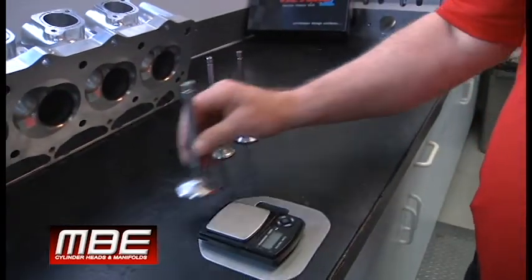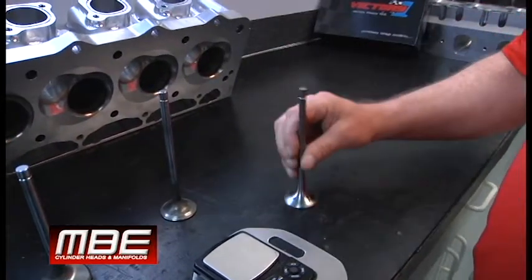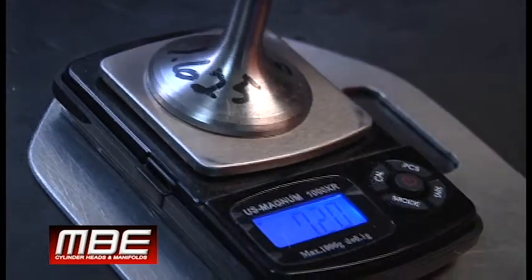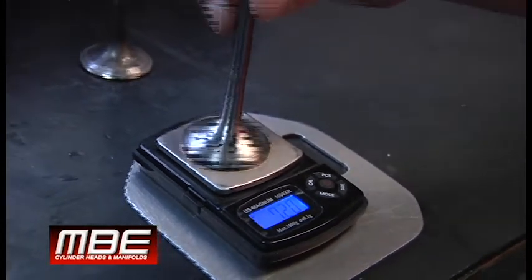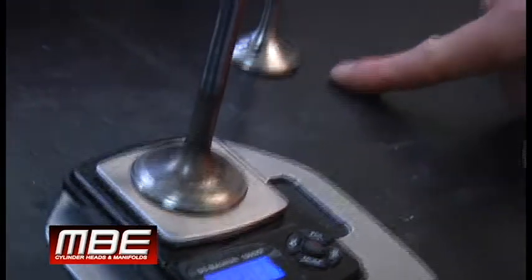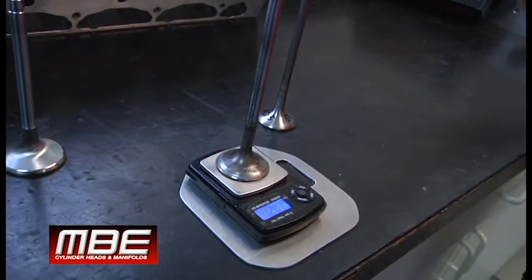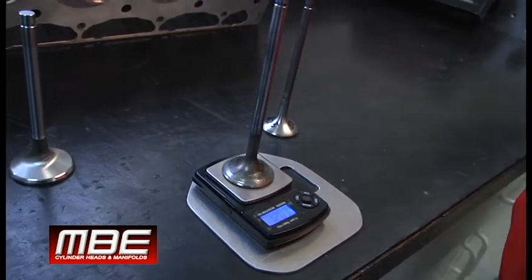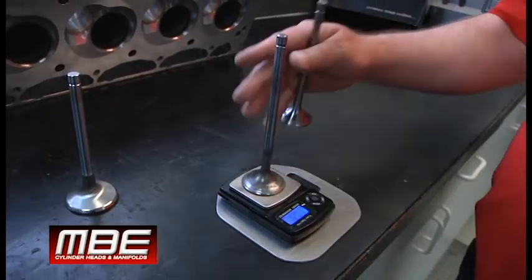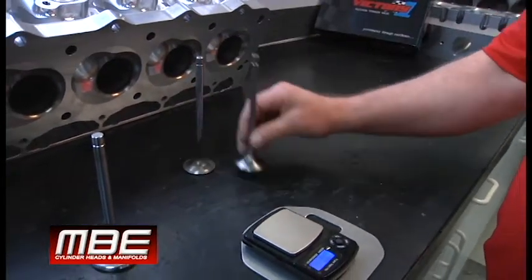The issue with the Inconel valve is the weight. We have Inconel, we have titanium. Here's your titanium valve — 72 grams. If this was 11/32 this would be about 74 grams, so not much different, about 3 grams. Now your Inconel is 120 grams versus 72. An Inconel valve will always weigh 60 to 70 percent more than a titanium valve. When you're refining valve train, finding 2 to 3 percent of valve weight is great, but when you're dealing with 60 to 70 percent more there's nothing you can do. This valve has a huge dish in it and it still weighs 120 grams — that's where it hurts you.